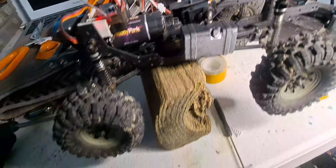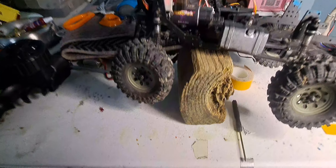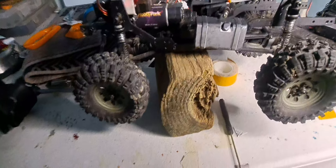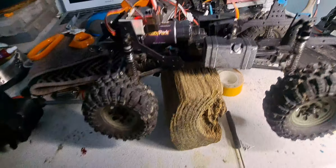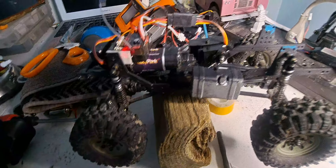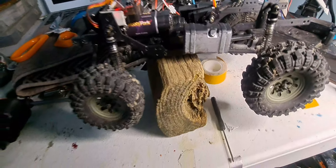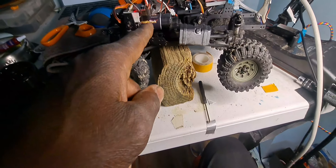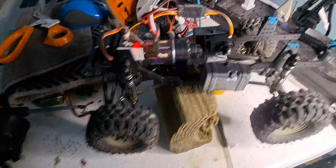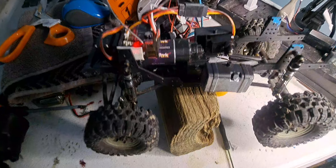I spent almost two hours — I had taken the truck apart and put in a 180 turn motor. As I said in the other video, if you want to go from the 130 to the 180, and if you use the Traxxas motors with the Traxxas motor pinions, it's the same pitch, so the gear mesh is perfect, as you just saw. That is a Traxxas TRX4 motor and it works fine in this little Hobby Plus Trailhunter Evo. Same pitch for the gears — in my other video I kept saying 'mesh,' I meant to say same gear pitch.